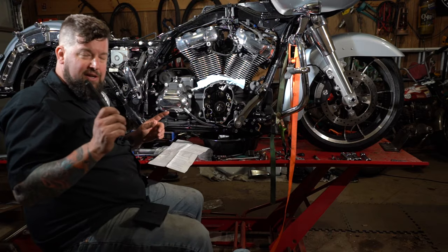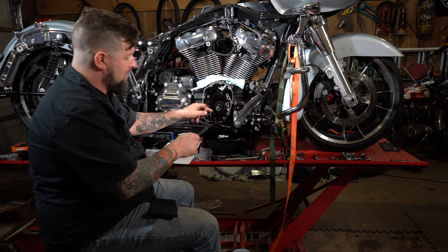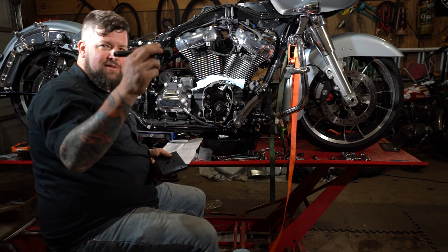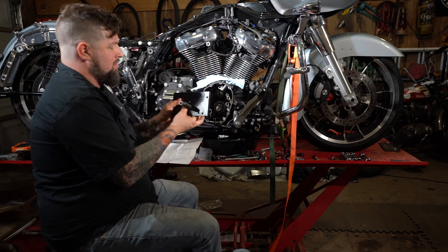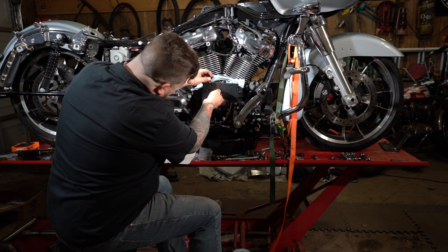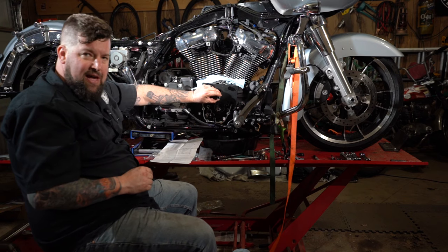So now it's inner cam bearing removal and reinstallation time. Got our tool here. Put some oil onto the threads to lubricate them. You see this little cone piece with a little taper on it? That's the piece that's going to go into the bearing. So you slide it through here, then you line it up with the cam bearing in there. Then you have the thumb screws that go in here and tighten up. So when you center this up, you'll feel it snap into the bearing.